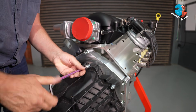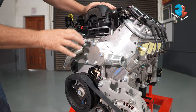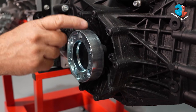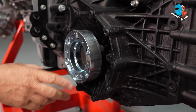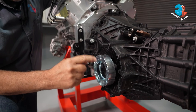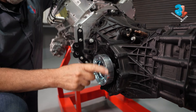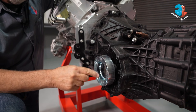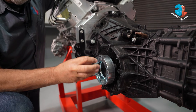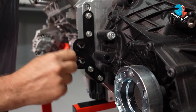Sian has done quite a bit more work on the engine, including adding the water manifold cover. On the V8 Stealth Beetle we use a Getrag gearbox — the same one you're seeing here. The standard Getrag or Audi box is built for a completely different application, so with this adapter we can fit our CV joints onto the adapter and then onto the drive shafts.